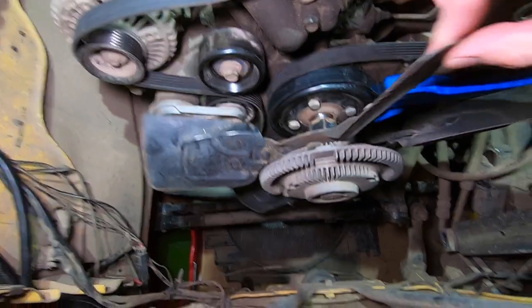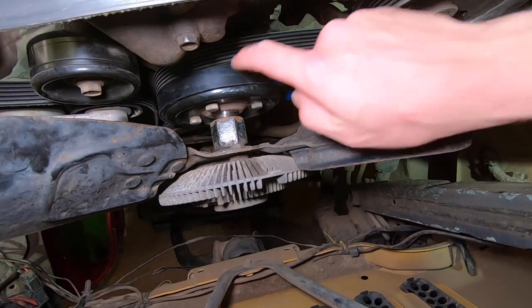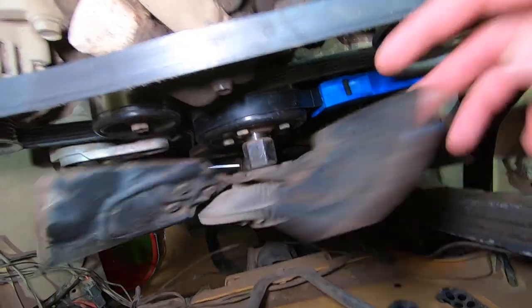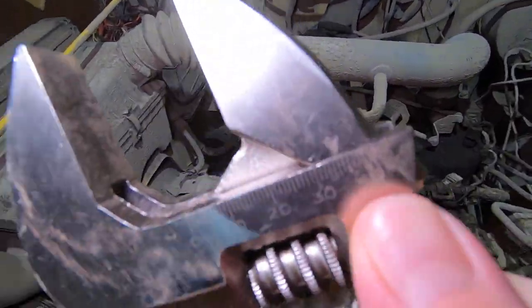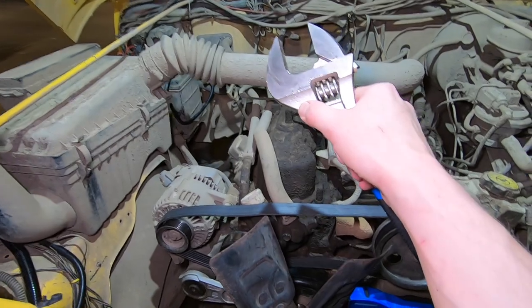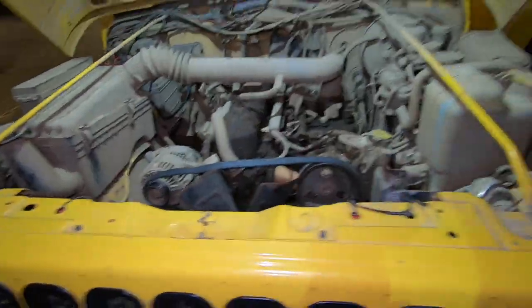What I ended up getting was a strap wrench, which you can see is holding the pulley in place. The fan is unscrewing - I already broke it loose with the other tool I grabbed, which was a large adjustable wrench. They usually say to use an 18-inch but this is a 15-inch, and it has adjustability up to about 40-45 millimeters. You need 36 millimeters to get this job done, so we lucked out. Time to get everything off and tear off that water pump.